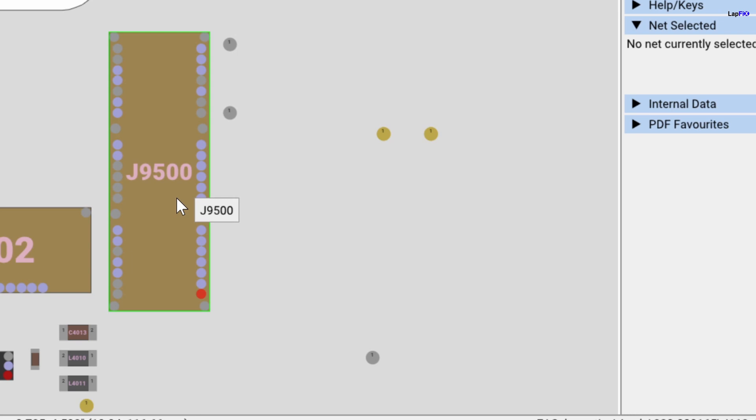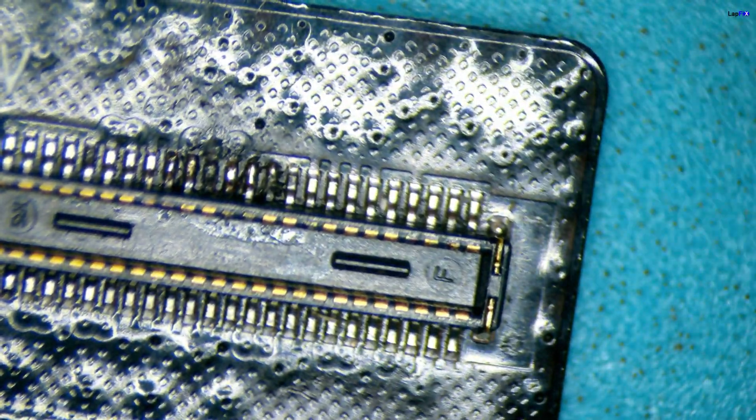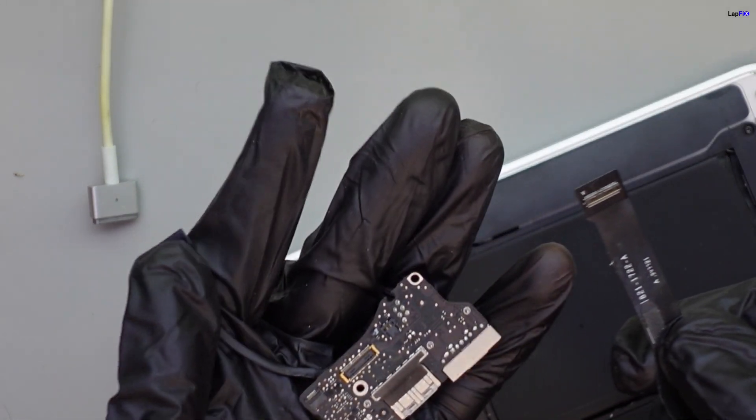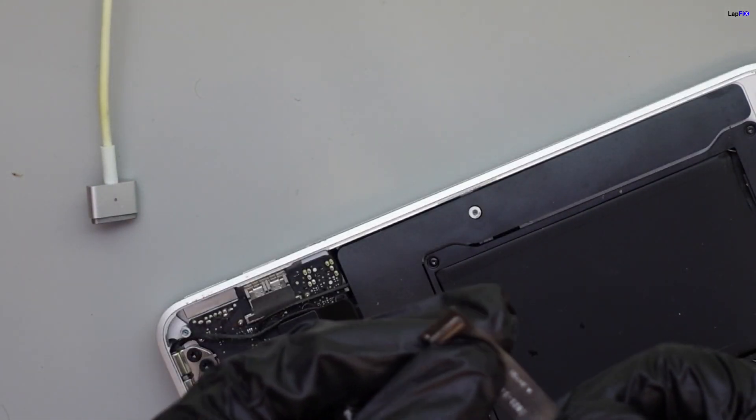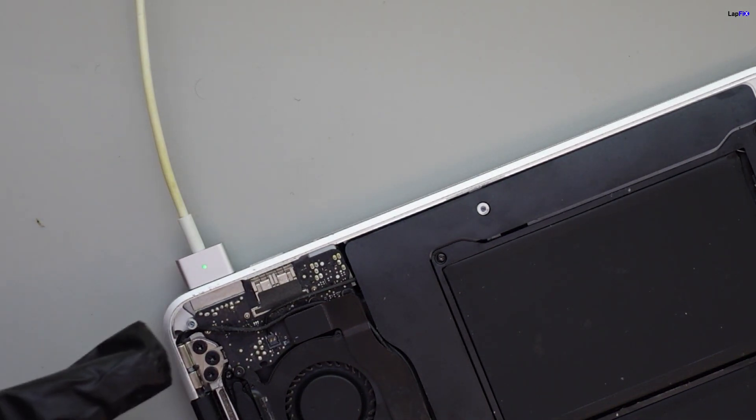This one doesn't seem to be too much of a big mess, so we can just do a cleanup. It's really not that big of a job — replace the cable and the IO board just to be safe. Check the board — board looks good. I don't really see much else going on. This looks like liquid to me — some type of corrosion on that side. We definitely don't want to reuse this one, especially with the pins looking the way they do. And on this side, where the part of the board connects — this whole entire trace looks to be gone. It looks totally burnt and it looks pretty bad. So for this one, we can just do a replacement cable, because these cables are pretty easy to replace. We replaced this cable and the IO jack — these are pretty easy, they're more modular. Obviously you don't want to reuse those same ones that are giving a problem. Let's go ahead and see what happens. Let's plug it in — you should get our light. And there you go.